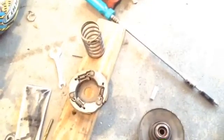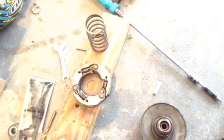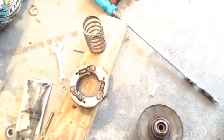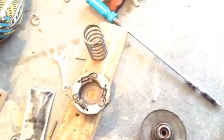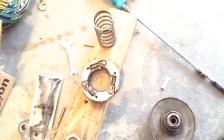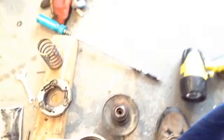Well, I did a lot of research, like a week's worth at least. But I just never saw this particular thing that says if you're going to go with sliders, they should be 1 gram higher in weight. A 4.5 gram slider is really like a 3.5 gram roller. So if I had known that calculation, I would not have bought 4.5 gram sliders.